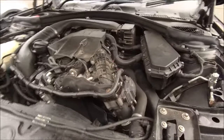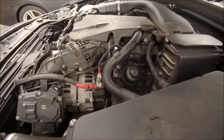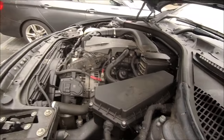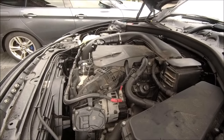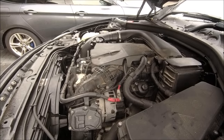Just a quick check for leaks. I don't think there will be any but always check afterwards just to make sure. Let it sit for just a couple of minutes and then I'll check the oil again and see where we are. I think I'm going to have to add around about half a litre - should be about seven and a half litres in these I've read up.